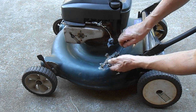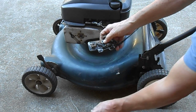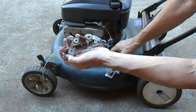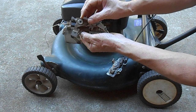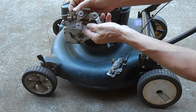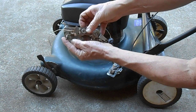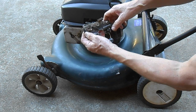As I showed in the earlier video, the engine brake is now engaged and this is where the wire connects to the ignition coil. The spring has been removed from this one so you can see how this moves. This is what kills the mower - when this touches right there, that's going to kill the mower. What you want to do is connect a weaker spring to this so your mower's always running until you pull it and engage that little point which goes to the ignition coil and grounds it out.